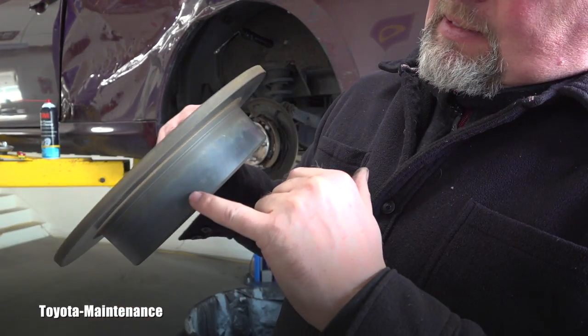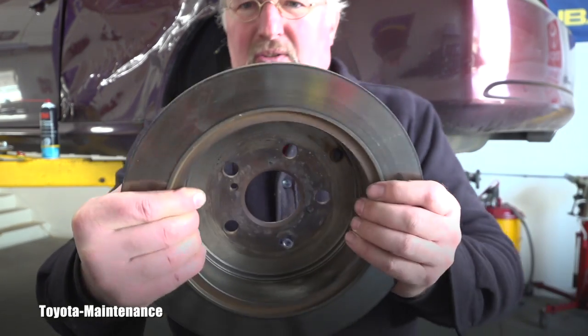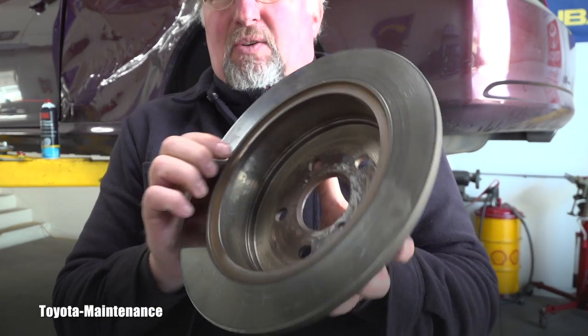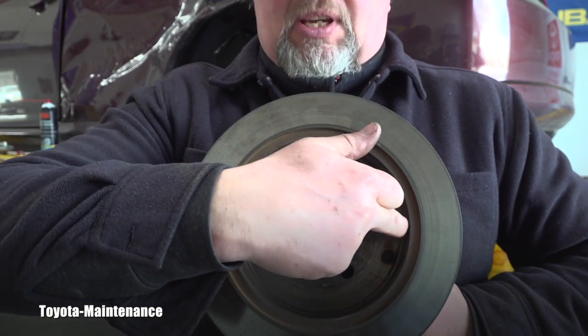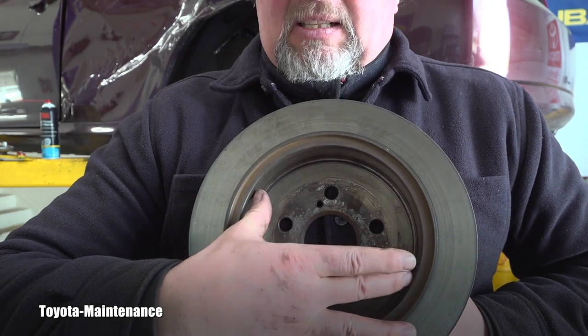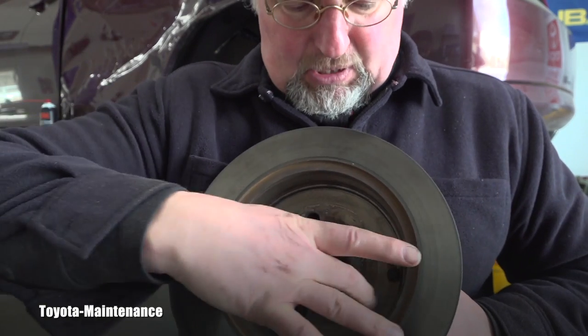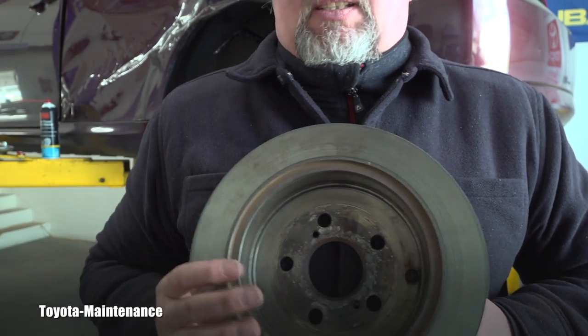Now what was the other number? You already know that — just kidding. The maximum diameter of 174 millimeters refers to this inner drum area, which can also get worn by the parking brake shoes. They are saying this drum cannot wear beyond 174 millimeters, so you measure multiple spots and it has to be smaller than that.